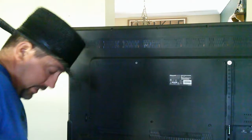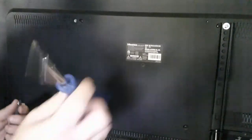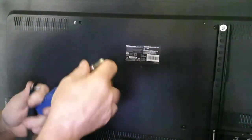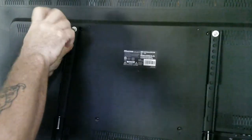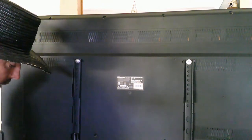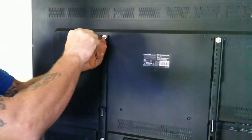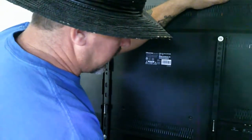I've already done that — I've got these guys because I've already put one on. This is a locking bolt that goes on the back on the bottom side. You put the screw through, grab your trusty 6-in-1 screwdriver — Phillips head in this case — and you put this on like so. Do the top one first because it's easier to locate the hole without fighting to hold it and put the screw in at the same time. Then put the screw in the bottom one and snug it up — don't push your television off the table.